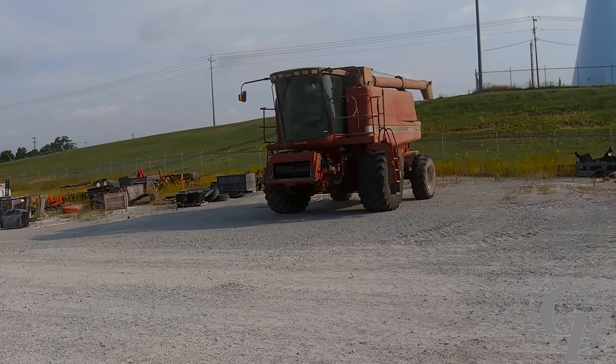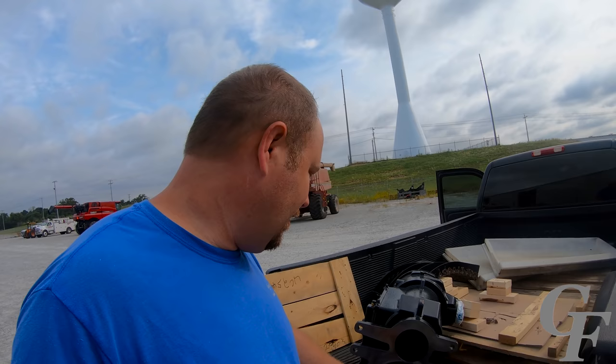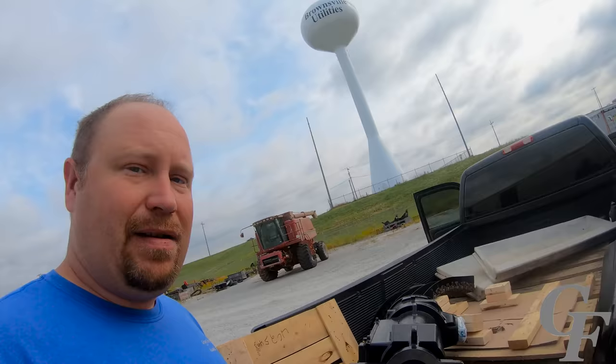Hello. All right, finally a little bit of good news. Yes, this gearbox will work. Yes, it does require some different parts. The gear that we got won't work because this one has taper splines on it, whereas the old gearbox had a snap ring and just had straight splines. Also going to take a bigger bolt and bigger washer. Luckily they had all three of those parts.